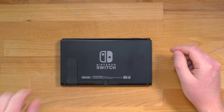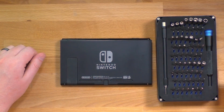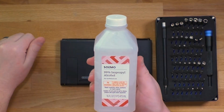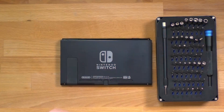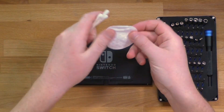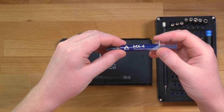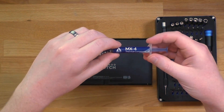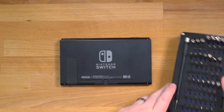Today I'll be showing you how to replace the thermal paste for a Nintendo Switch in all three locations. What you're going to need for this job is a screwdriver with a 00 Phillips and a 00 Y, as well as some isopropyl alcohol — I like to use 99% — and some cleaning utensils. I'm going to be using Q-tips and cleaning pads, but any cleaning utensil like that will work. You will also need some thermal paste. I'm using Arctic MX-4, but any thermal compound with a good rating on Amazon will work. I'll have links in the description below with the tools and the thermal paste.